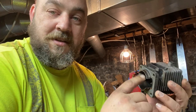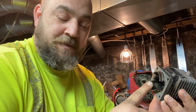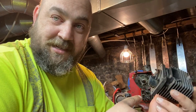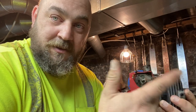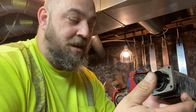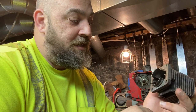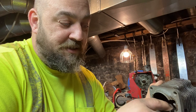We've got a little bit of scoring in the cylinder and we're going to see if we can get it cleaned up, because once the base gasket's off I redo the numbers. But I'm not going to redo the numbers on a cylinder I had to throw away — if I have to get another cylinder, I'll do it with the cylinder I want to use. I'm going to check the numbers on the cylinder I'm using, but I do want to know my starting point. Next time we're going to see if we can clean up this little bit of scoring.